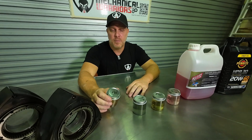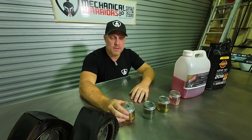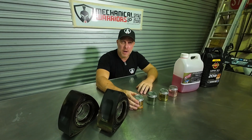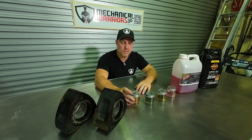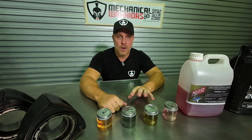In summing up: if you've got a rotary, especially a turbo rotary, premium 98 is the least expensive fuel you can use — just don't exceed 16 pounds of boost. Anything higher, you need to experiment with other fuels, and of course you'll need to tune your engine to suit if you're going down that road.